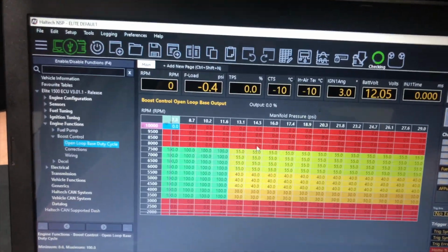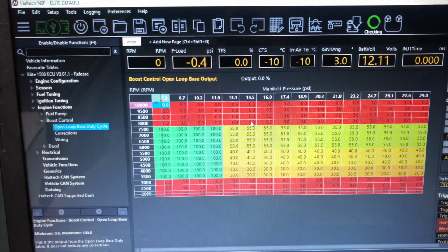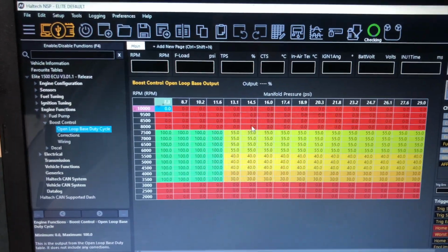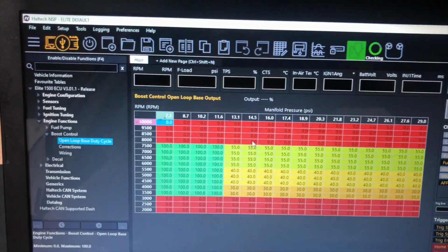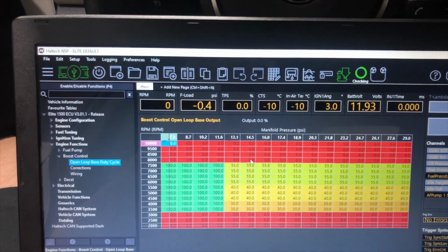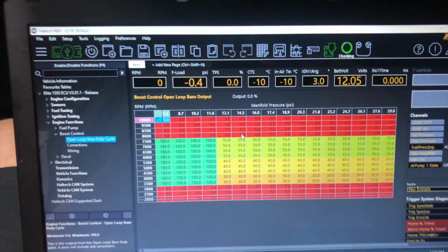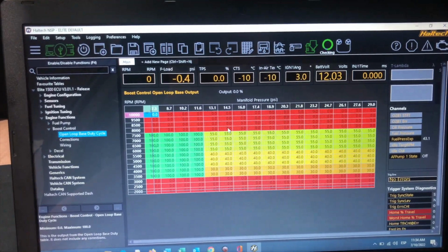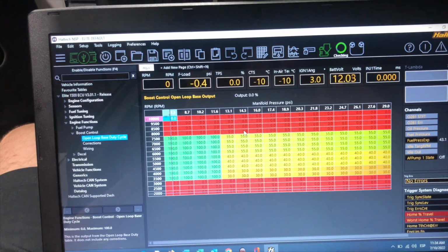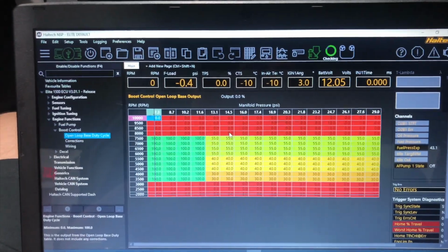Okay, and as soon as I turn the ignition off, wait 5 seconds, the Haltech shuts down. This is something not many people do when wiring external ECUs, and it's getting switched power to the ECU. When you don't do that, you start having issues with the battery draining, because the ECU is going to start turning off an hour later, or 20 minutes later, or fully staying on, because you take the power off where you are not getting switched 12 volts.